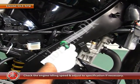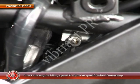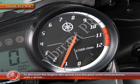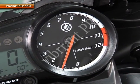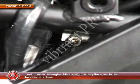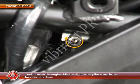Check the engine idling speed and adjust to specification if necessary. To decrease the engine idle speed, turn the pilot screw anti-clockwise with a screwdriver, and to increase the engine idle speed, turn the pilot screw in the clockwise direction.